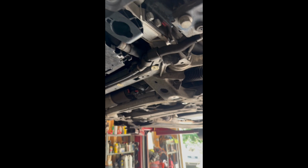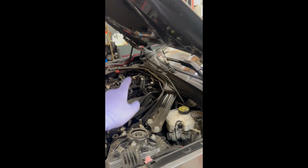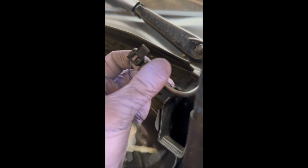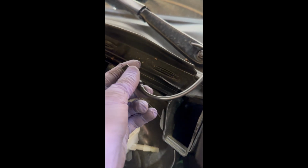Went ahead and disconnected the oil coolant line, and also went ahead and popped the headlight level sensor off its ball socket right there. Went ahead and disconnected the 48-volt battery and the 12-volt battery in the rear. Popped this windshield washer union off. Basically just a U-clip, pried out the screwdriver, and you can pull this out.